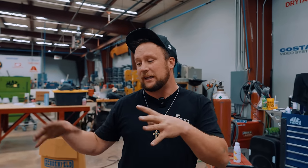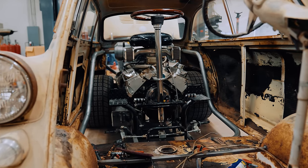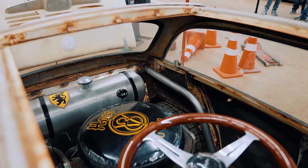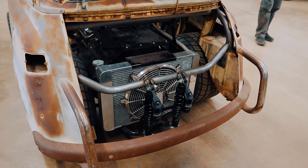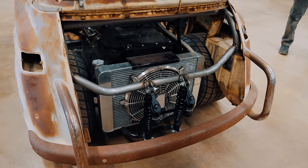All right, guys, so we got our chassis built inside of our Isetta. It's kind of a framework. This thing really was rotted and nasty, so we built an exoskeleton around the Hoss Fly just to encase it and make it strong enough so that when we're in there, it doesn't rip itself out. While we were doing that, we kind of got carried away and went ahead and put the rear suspension on and got it all mounted in there. Sorry you missed that, but it's there.